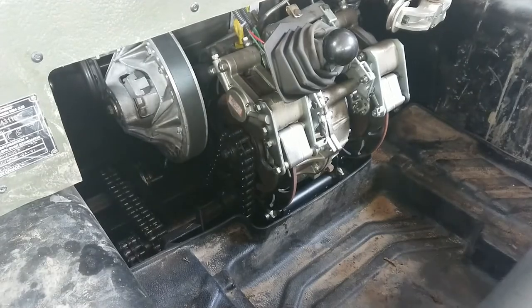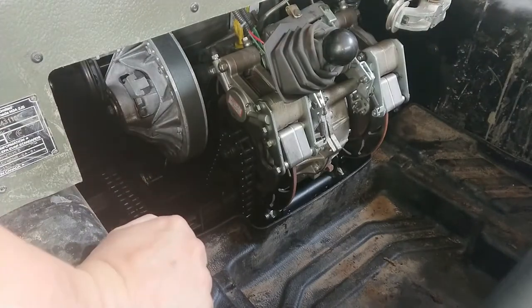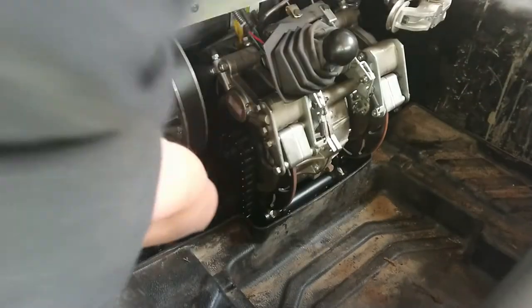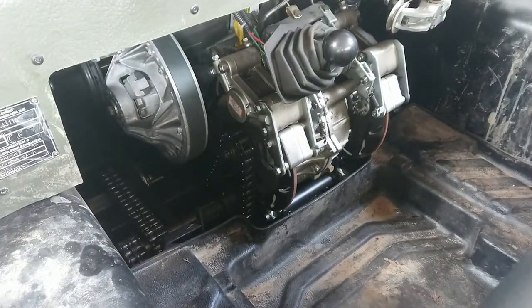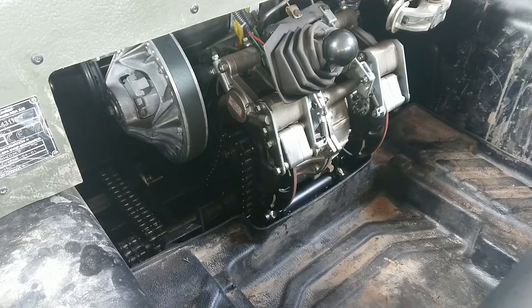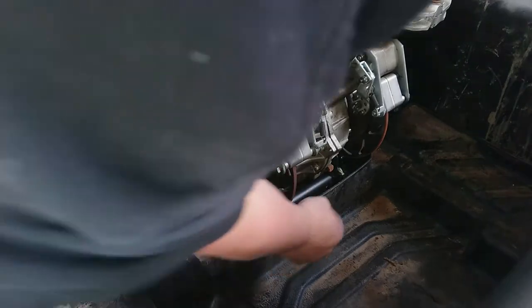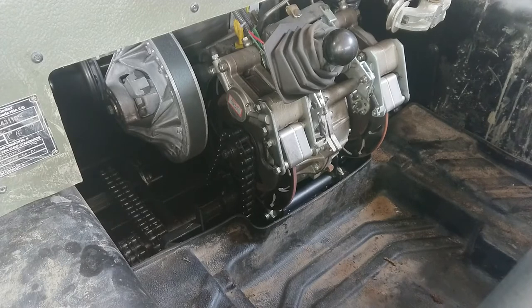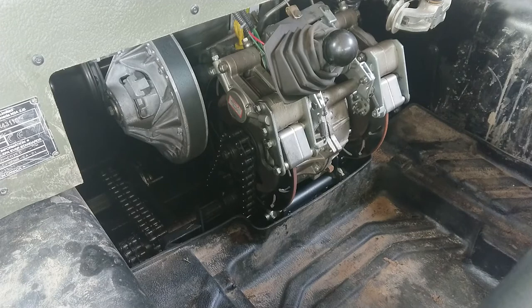All right, so I was one piece of heat shrink away from being done with this winch project, and I dropped my lighter in the engine bay. I think I can see it. I got it easily enough this time, but that firewall is something I really begrudge having to remove. However, I do have to change gearbox oil anyway, so while it's out, I might suck the oil out, and then I'll pull this drain plug out and then do all of that, because we're up to our 25 hours of runtime, or 20 hours. So a gearbox needs its very first oil change.